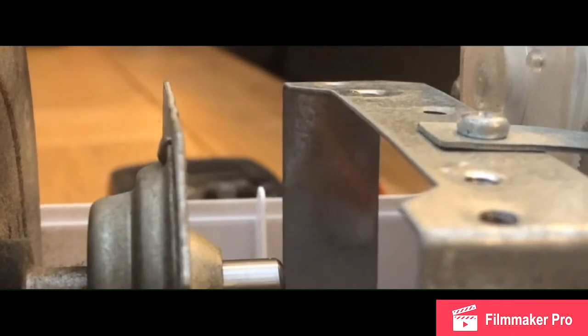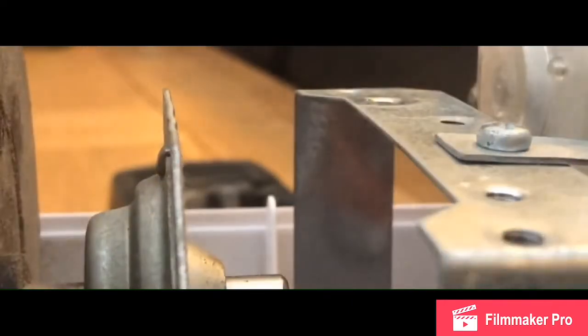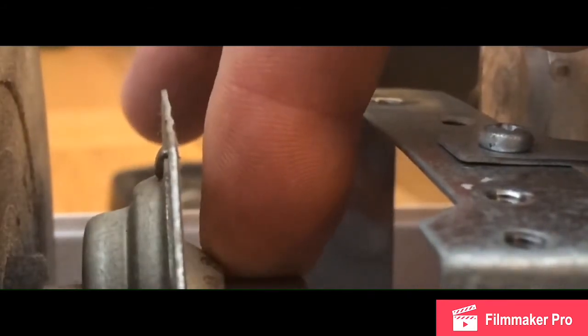I think the next thing is further cleaning of the plastics — I'm not going to put that on film — and then we'll reassemble and test. I think I might have worked out the source of the noise. While the camera was down I had a little investigate. There was a little bit of play in this shaft, and you can hear it better if I bend the bracket. So the solution to that is to bend the bracket there, and the play seems to reduce. So hopefully that should work. I think I might put a blob of grease on there just to absorb any further vibrations.